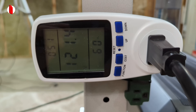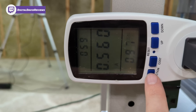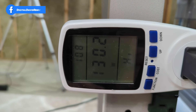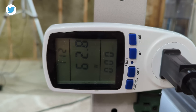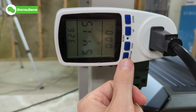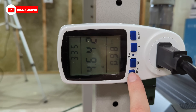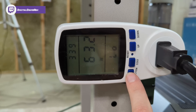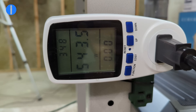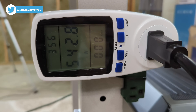Now for a little field trip to check the power settings. With the computer at idle, we're at 121.4 volts, 0.56 amps, low watts 63.2, and high watts 130.2. Maxing it out under full CPU and GPU load, we're getting about 542 watts, 119 volts, 4.57 amps, and a high reading of 548.4 watts. We're still hovering right around that under full load, which means there's still plenty of headroom for this particular build with this 1000 watt supply.